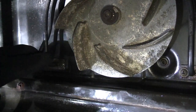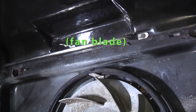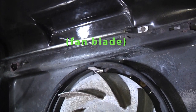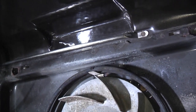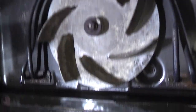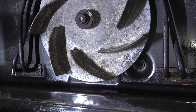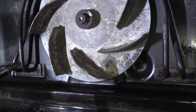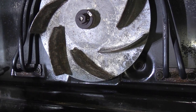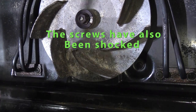To get the elements out we need to remove two screws on each side. Just above the fan there's another clip — I looked online and it says you need to remove the fan to get that out, but it's actually split. So I'm going to leave the fan blade and just split it at the top. I'll use a screwdriver with a PH2 bit, having sprayed these with spray penetrant about 15-20 minutes ago.